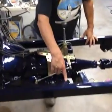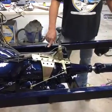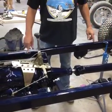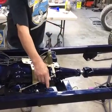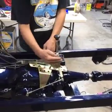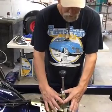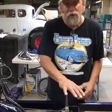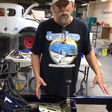I've got a body mount hole here. I've got a body mount hole here. The 27 is a little harder because you won't see these holes. They're pretty far back under the car. But if you just go from these two holes and triangulate it with a measurement, you can draw a straight line across that. You can come across here, make a straight line 90 going that way. You can measure. You can get your rough cut. Don't cut too big. Just get a hole big enough to get your shifter down, especially if it's the first time you've done it. Then you can set your body down on here.